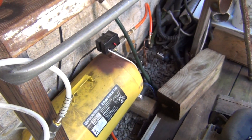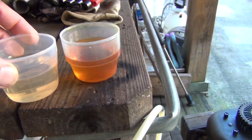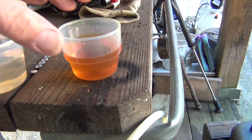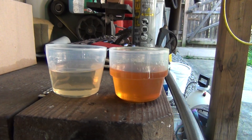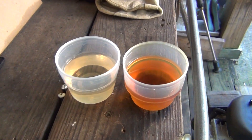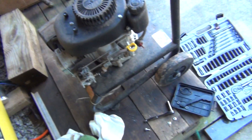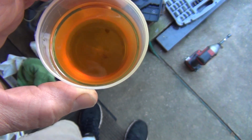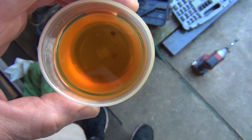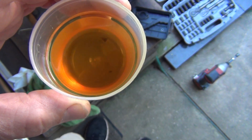Compared to fresh gas, this is pretty much what you have here — this one is fresh, this one is old. Let's put them next to each other and you can see the difference in color. Interestingly, this one doesn't have anything at the bottom, but this one here has water at the bottom — you can see just a little bit of water settled there.